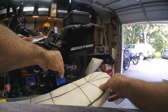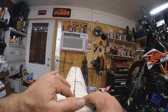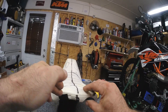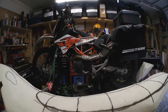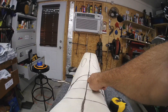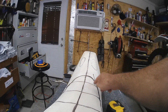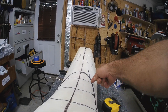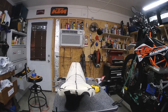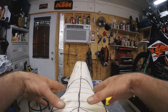I used my little stick pin to determine where the seat depth is. Draw one line in the middle, then do one contour on one side. Once I have one drawn and I'm satisfied with the contour — that it seems natural — I can then go from my center line, measure to here and then measure to there to know where to match this contour. I just did that all the way down, and what you end up with is a fairly symmetrical, uniform contoured area.